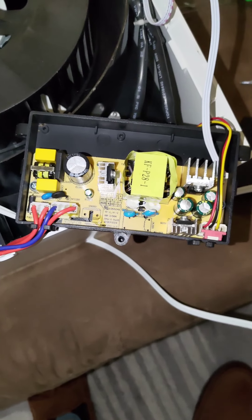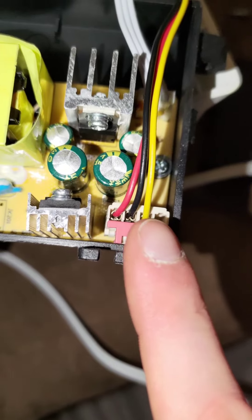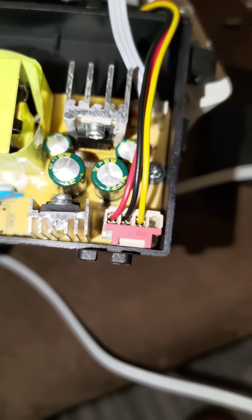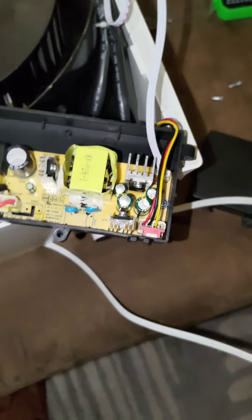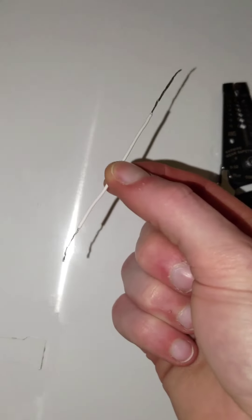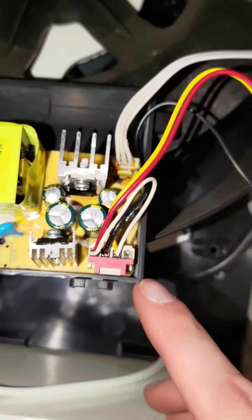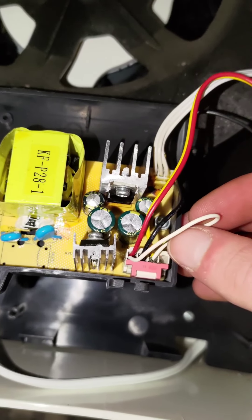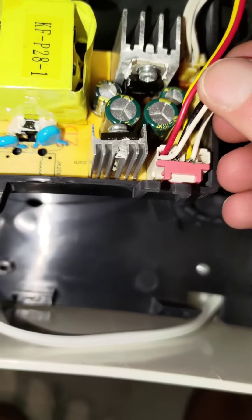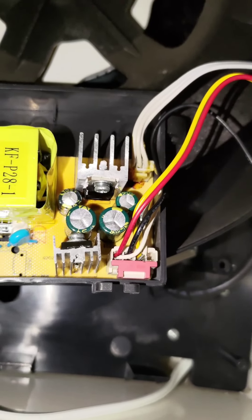This is what it's going to look like once you pull the cover off. What we're interested in is this little spot right here — see the red and the yellow wires? You're going to want to short those together with a wire. Just get some wire strippers or borrow some from a friend. It really doesn't matter what gauge of wire — just get a decent size piece. Strip the ends pretty long, bend those ends a couple of times so you can just shove them in here, and they'll be held together by that force. Then just bend the wire and tuck it in there, and now it will just run on high on its own.